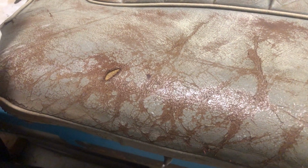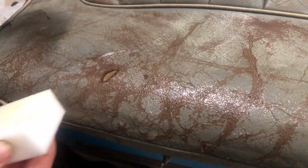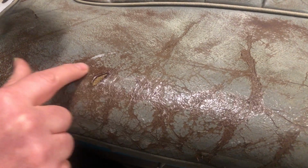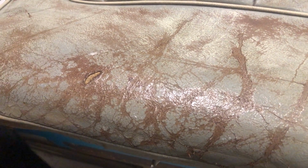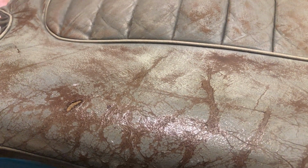But personally, with it being a classic car, I'll just leave this to soak into the leather overnight, and then the following morning you can give it a sand and proceed with your heavy filler and Flexi Fillers as required. You can rub it in with your fingers because they're all water-based products as well, but we just put it in with a sponge and get it really soaked into the leather. It's just going to bind all those fibres, pulling them back down so they're stable again, so that you can sand it lightly, and you're still going to leave a sort of grain impression in it, and it's going to look just as good as it did originally.